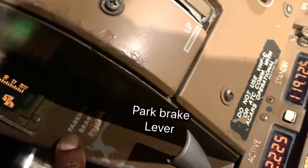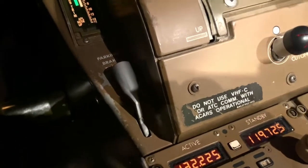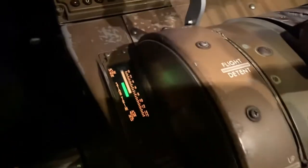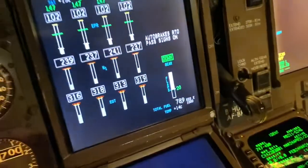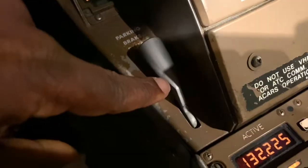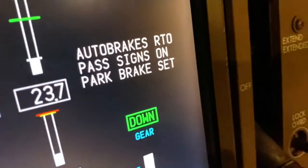So the park brake is set. This is the park brake lever here. The brake is released by me using my feet. I'm going to release the brake now and see what happens to the lever. Park brake off because we've been cleared for takeoff. I've just moved the stabilizer trim back into the green band — stabilizer is in the green band, that's correct. Flaps on flaps 20, which is a takeoff flap setting. So now I'm going to put the park brake on — I depress the pedals, pull the lever, release the pedals, and the lever stays up in place. Up here it says park brake set.